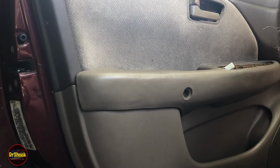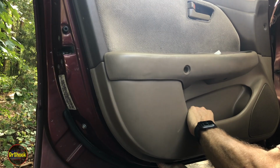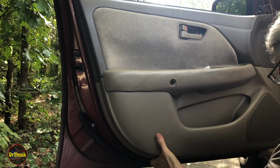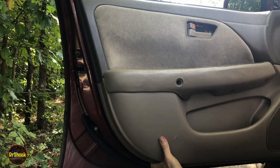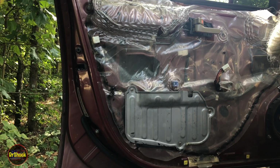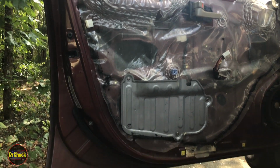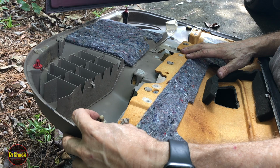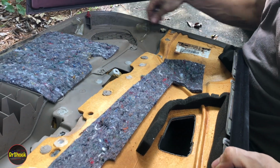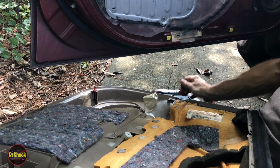Now we should be able to take a plastic trim prying tool, and it's just held on by some push-in retainers. And then you may have some debris come out as this guy lets go. One of the things you want to look at when you do something like this, that came off way too easy. And so what I'm looking at is down here on our panel, we've got a clip here, and we've got a clip here, and these can sometimes be red or white from Toyota. But one here, this one's broken. So one of the things we've got to do is replace this broken clip. I'll go ahead and put a part number for that down in the description.